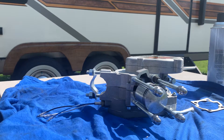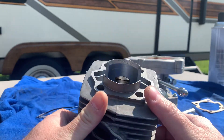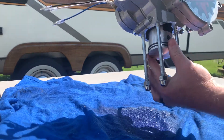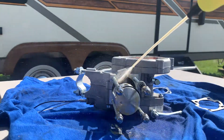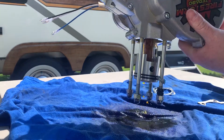A million days has passed since I took this apart, so I'm going to blast her — literally, I'm going to blast her with some PB Blaster and some brake clean and all that nonsense. Let's get the chunks out of it. I'm going to hone these burrs off with the proper tool and we'll see where it goes from there. Just trying to get the big chunks out of there because when I pulled it apart, it didn't look great.